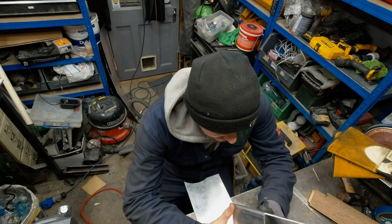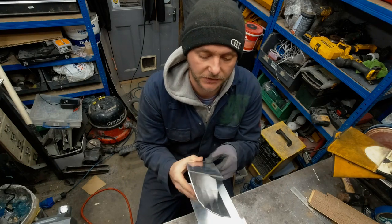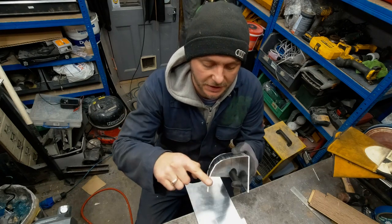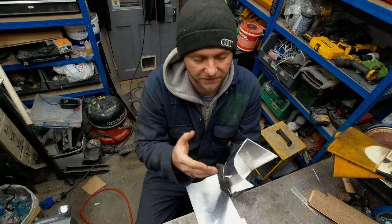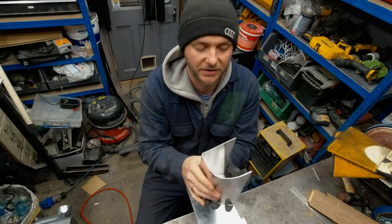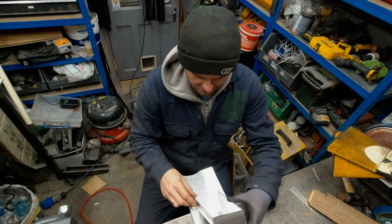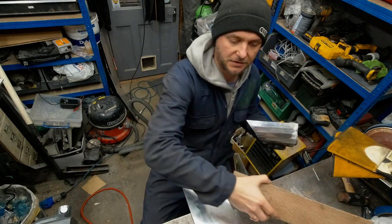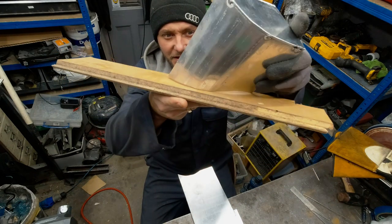The issue I found is that when you bend a radius, even if the two sides are parallel at the beginning, once you bend it, it stops being parallel, if that makes sense. So, whereas before, if it was right angles, I could put a plate and it would just cover everything. Once you bend it, as soon as you put it down, it has two sort of gaps, as you can see like that.